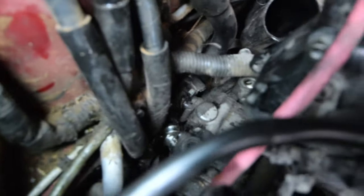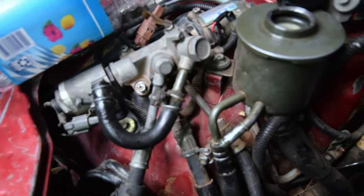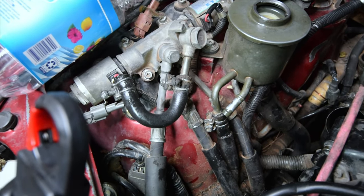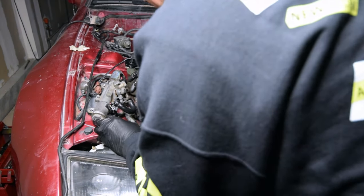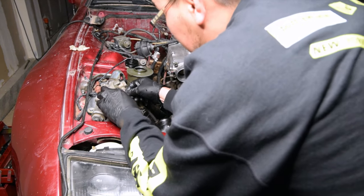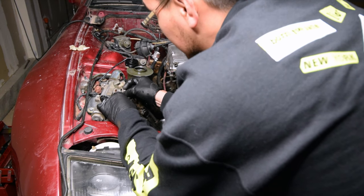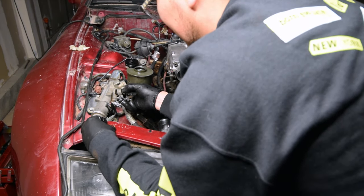That line goes to the power steering pump right there, and it's also held right there. You can see that other line also connected to the power steering — if we follow that up, it takes us to the HICAS system right here. I'm going to go ahead and remove both of those because I can't figure out how to disconnect this power steering line. Once we disconnect both, I can reverse engineer it and let you guys know the proper way. When removing the HICAS bolt, it's another banjo bolt — you're going to have a washer on this side and a washer on this side, so be careful.